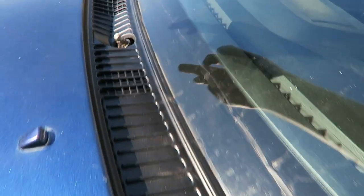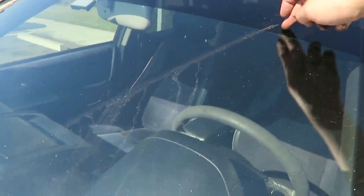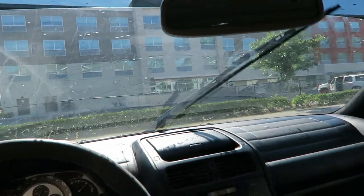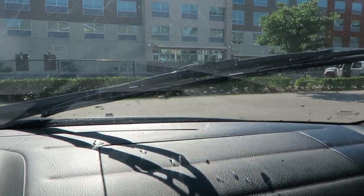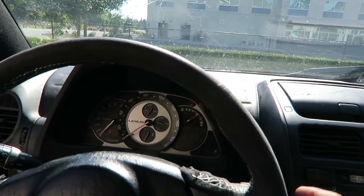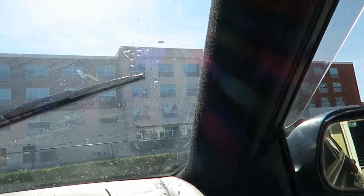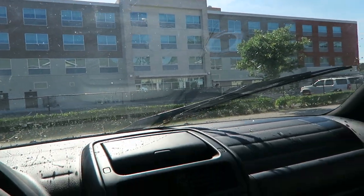Now for the original reason we started this video — I'm just going to put on the one windshield wiper, double check it, and make sure the full swing doesn't hit the side of the car. Okay, let's check it one final time. It doesn't hit. Four fingers here, about three fingers here — so essentially I could move it another inch, which I'm probably going to do. All right, final test. It stops about that much on the return swing, and when it rotates it's almost centered. I'm going to call that a win.